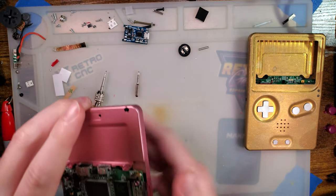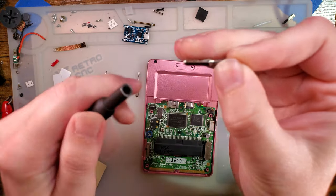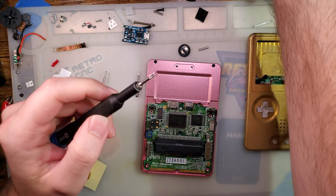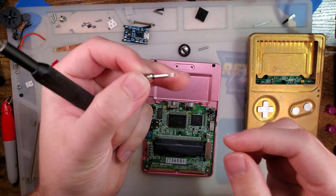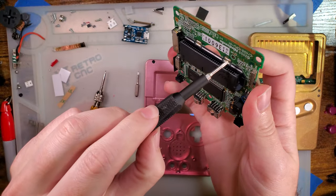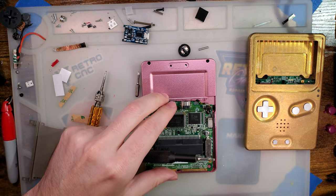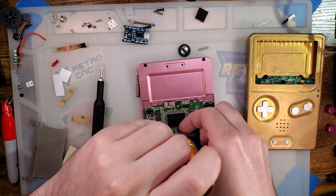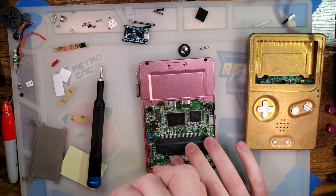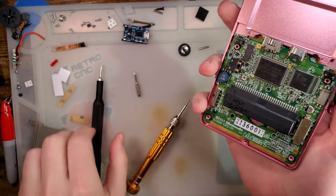The solution — because I've just spent so many minutes waffling about a problem without talking about possible solutions — take a Torx driver. A T6 or a T7 should work; I'm using a T7. Depending on your specific drivers, you might need to use the bigger one, but for the iFixit kits, because they're tapered, both will work. The idea is we're going to use our Torx bit as a reamer. Literally, I'm just going to stick it in the screw hole, give it a couple twists, and then pull out. That's it. Now I can thread that in, no problem — it goes all the way home.